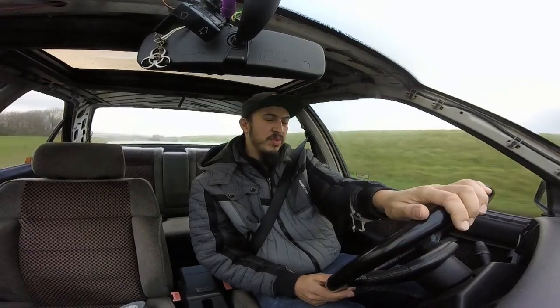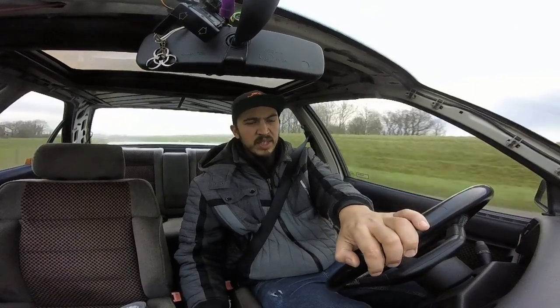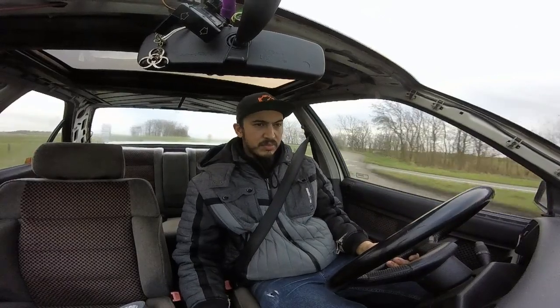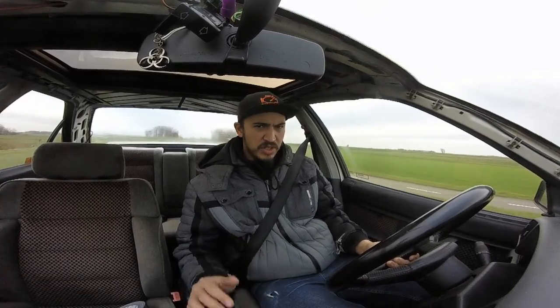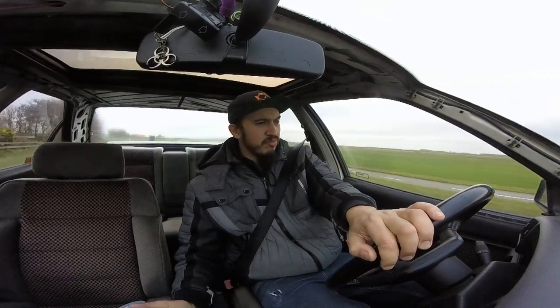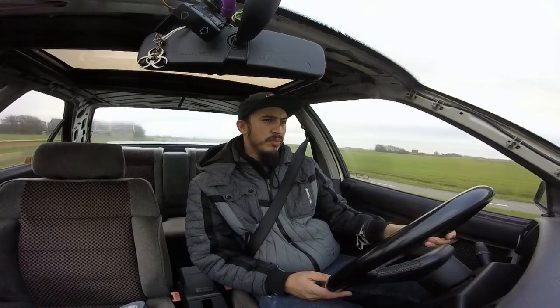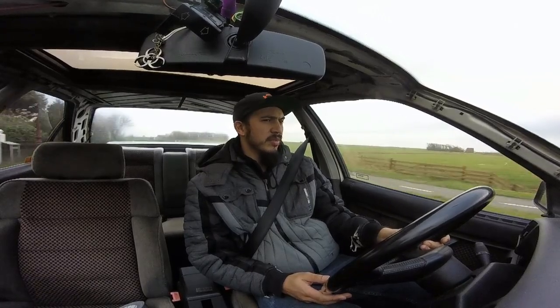Getting the headliner back in is something I'll do in an upcoming video, probably in February or so. Also, I've quite forgotten — I have to replace the alternator because it's only charging at 13.5 volts. It's not broken yet but it's not enough, it needs more than that.